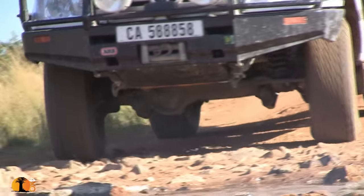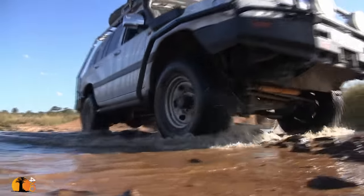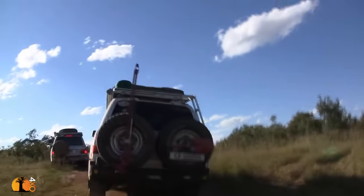Especially airbags fitted inside coil springs. I drove a vehicle like this once — it was a mate's 105 Series and it was grossly overloaded. He had the heavy springs in it and it was still overloaded. We actually weighed it — it was over GVM by something like 40 kilograms, empty, no fuel, no water. I said to him you have to lighten it and take some stuff off. He was a bit of a stuffaholic. He asked me about airbags and I said it's going to ruin your ride.